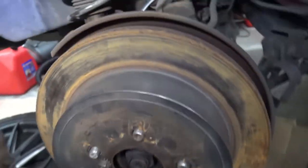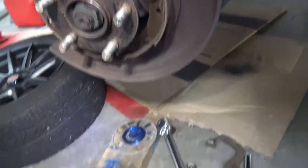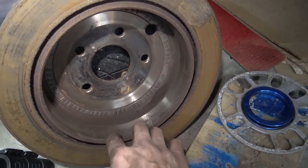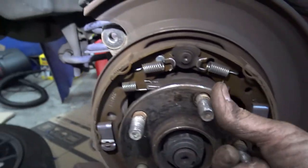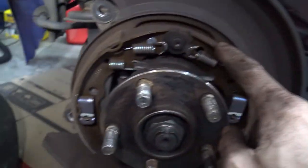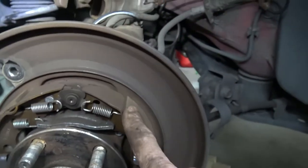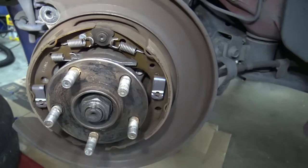I can see it moving — it is coming off. So now you can see how the system works. We have a drum built into the center of a disc brake, and there's our hub. There's a small drum brake in here, just like in an old car — just like in this Camaro — except a small one. And that's your emergency brakes. When you pull the cable, that forces the shoes out.